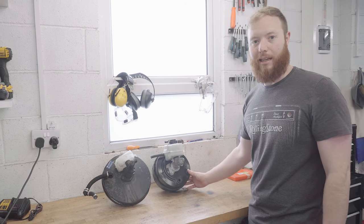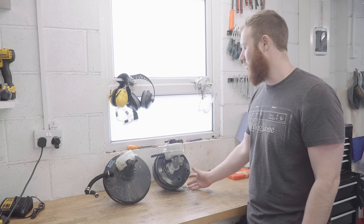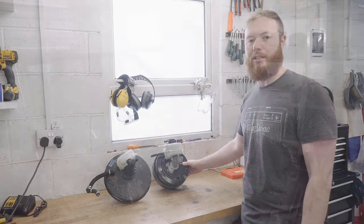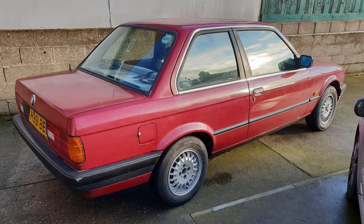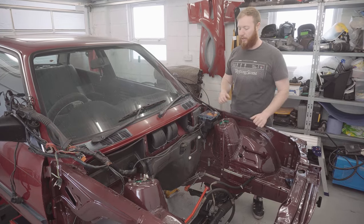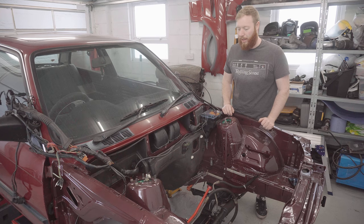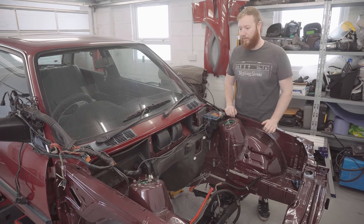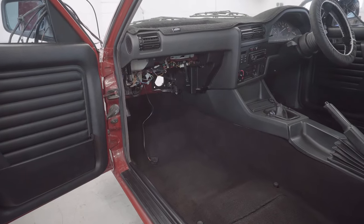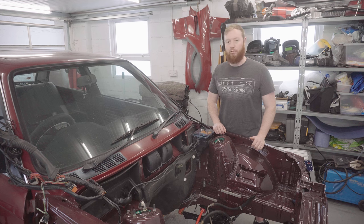Now that doesn't mean this is going to be easy, and there are still quite a few things to be aware of. I found a lot of the information is quite fragmented around the internet, so I'm hoping to bring it all together into this one video and show you exactly how to get an E90 booster working in your E30. To give a bit of context to this E30 build, it's actually a 1990 coupe — a 316i in absolute poverty spec — and as you can see the M40 engine is removed and I'm planning to fit an M52 engine. It's right-hand drive because I'm in the UK, and there's no ABS, which are key points for this conversion. Whether you've got a left-hand drive or right-hand drive E30, hopefully this video will have the information that will really help you out.